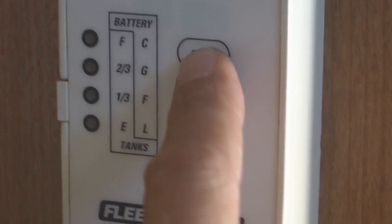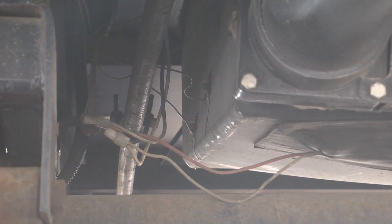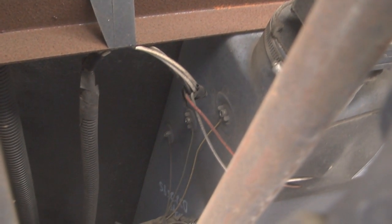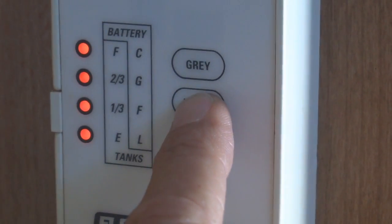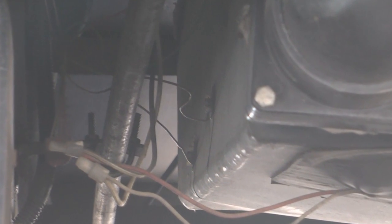Unfortunately, these are one of the first things to fail in an RV. I just dumped both of the holding tanks and they're showing totally full on the readout. The problem is not the display itself, but these sensors located on your tanks. These sensors operate on the simple principle that water conducts electricity. As the water level rises from one sensor to the next, the corresponding LED on the display lights up — simple and effective, until they quit working. The system begins to malfunction as debris builds up on the sensor terminals inside the tank. This debris can be anything from food particles in your gray tank to toilet paper and other nastiness in your black tank.